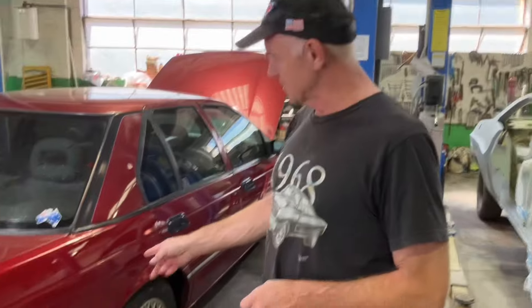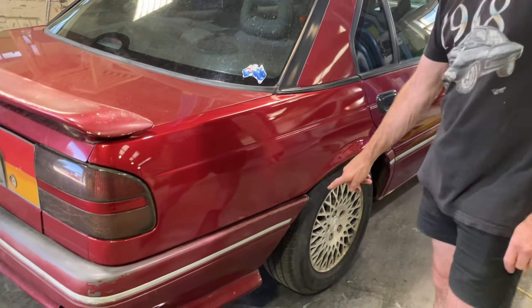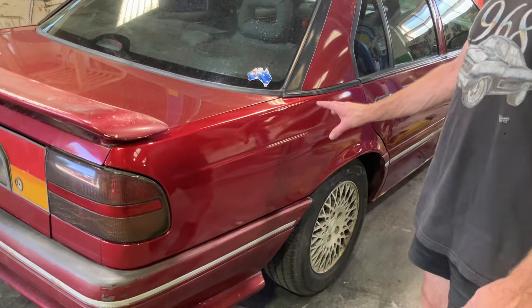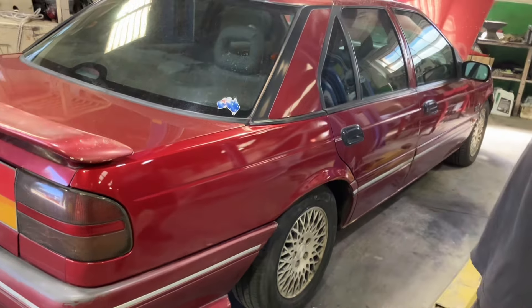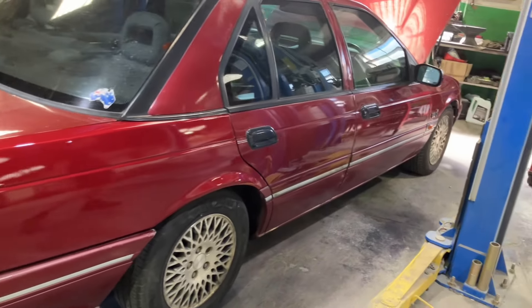We concentrated quite a bit of time on this quarter panel — it was pretty nasty. The wheel arch had been flattened right off, it was caved in, rusty in the corner, and had several other dents. I'll put a shot in there of what it looked like before. We didn't worry too much about the color match because Mark's considering painting the whole car at some stage, so it's the original color straight off the mix. That's coming along really well — I'm happy with that.